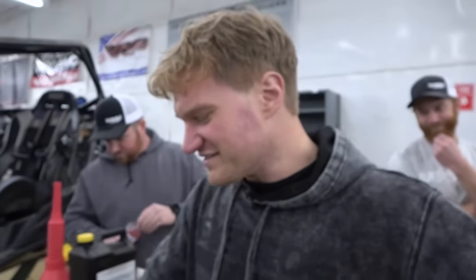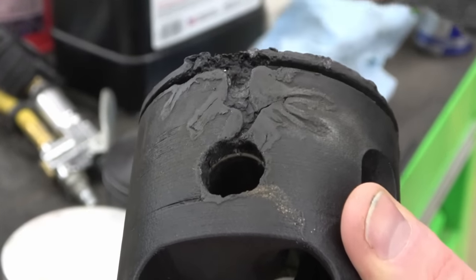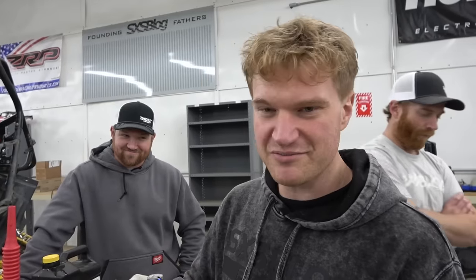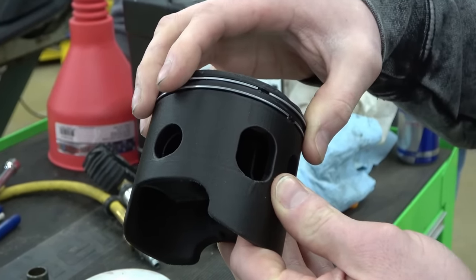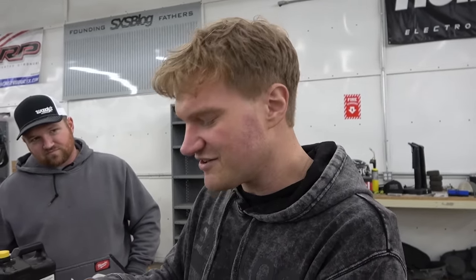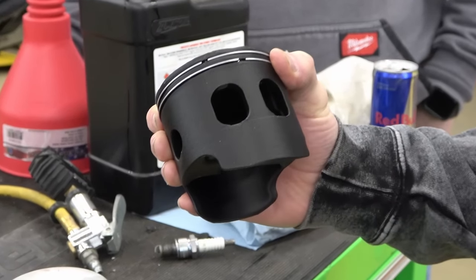Well, some stuff happened — it's been a few days. We got the piston out. Combustion was getting behind the ring and just melted it down to the wrist pin. Off camera we threw a real piston in it and the thing started right up — made over 100 PSI of compression, no problem. So for the next attempt: we hollowed it out to look more like a normal piston in case transfer flow was an issue. Put the double rings back on and tightened the ring grooves to stop gases getting behind the ring. Raised the dome even higher and increased the diameter a little more so the piston itself helps seal — not relying entirely on the ring. That piston looks excellent.